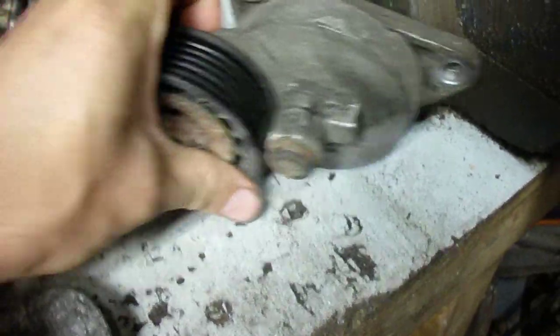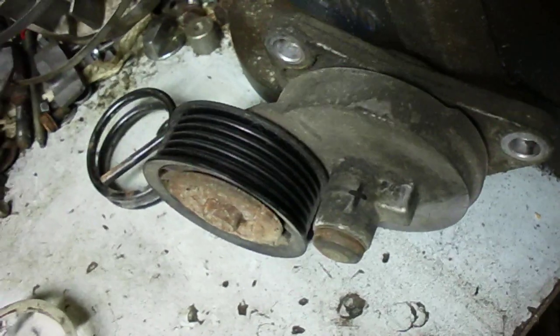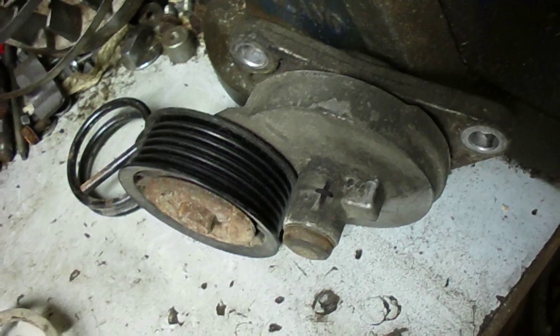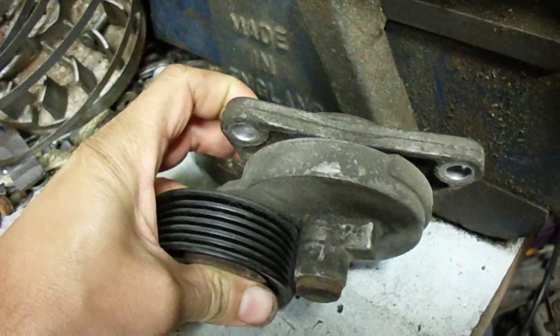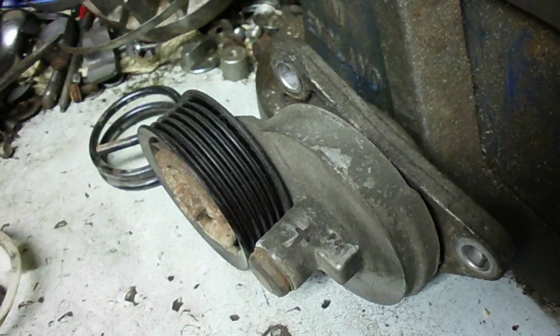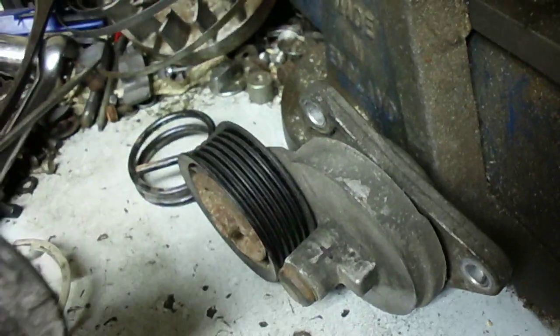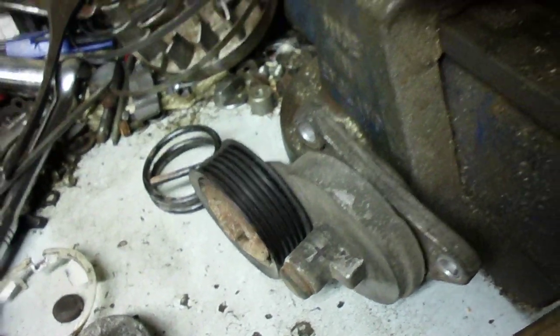What I'm going to do with this one — and I'm even thinking of doing it on the new ones — is drill a small hole, just over a sixteenth of an inch, roughly where I've marked an X. I'll drill right in until it touches the steel, then put oil or penetrating oil in there to lubricate the shaft, pack the hole with grease, and then it'll become a regular maintenance item to add oil so it doesn't seize up again.